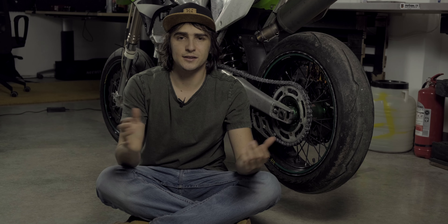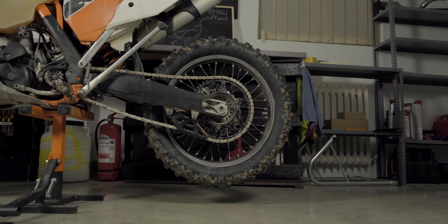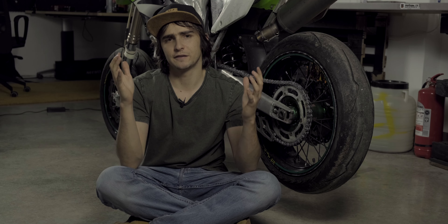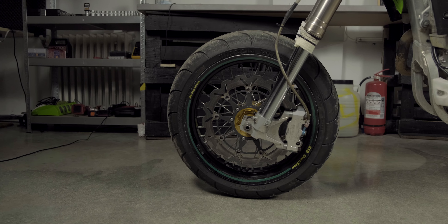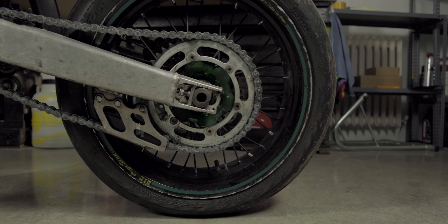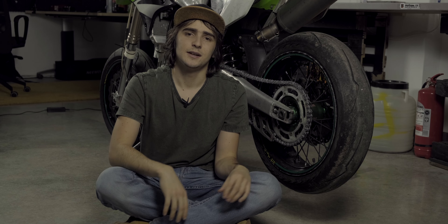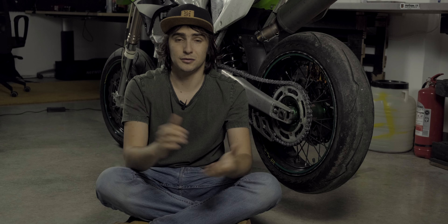Arguably the most important aspect is wheels. Dirt bike wheels are big, and just like a sumo athlete, while being extremely resistant, they are kind of hard to handle. Big means a lot of mass that needs to be leaned into corners, and that's no bueno. The answer is simple: just put regular street wheels on. Usually this will consist of a 17-inch pair of rims, but sometimes for racing, some people do opt for a smaller 16.5-inch front wheel, like in the case with my steed. These wheels are usually tubeless, so no need to keep around your rusty tubes.